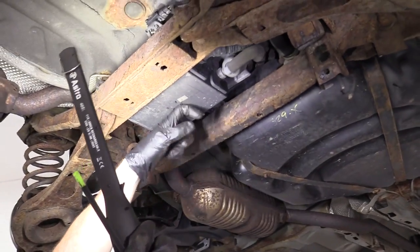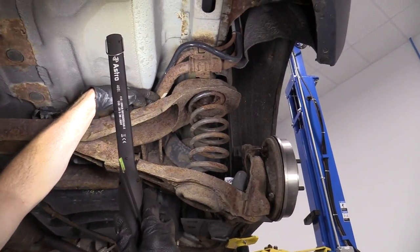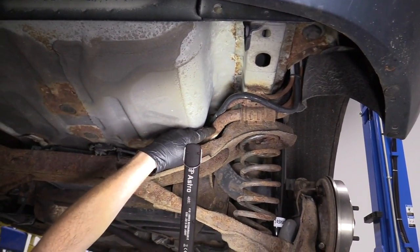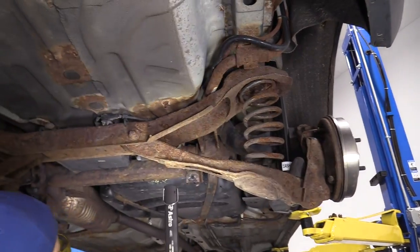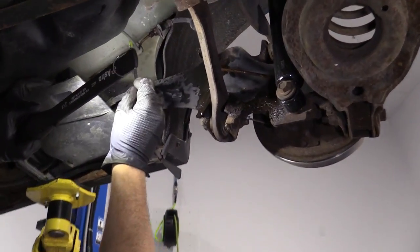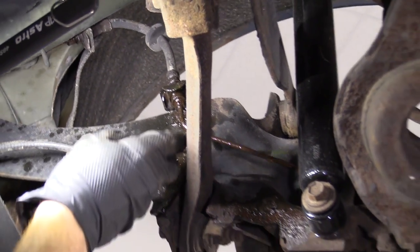The shock bolt is going to need to come off because the shock goes up to the body of the vehicle and it holds this arm. Some vehicles have the evap canister here, so once we start lowering this down, we'll be able to get that out of the way. Pay special attention — make sure that as this starts coming down, nothing is somehow attached where you can't see it. You've got brake lines which come right along here, down along here, up to this bracket, and then you've got your flex hose that comes down to this bracket, which is part of this arm, and goes down to your wheel cylinder.